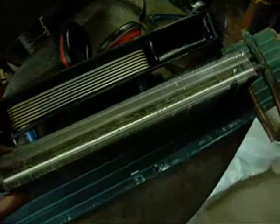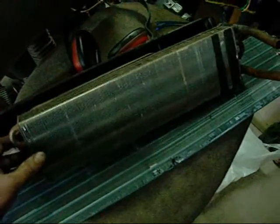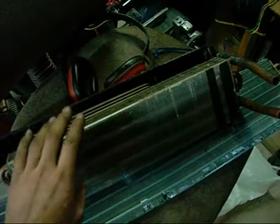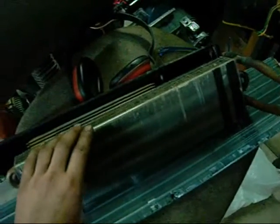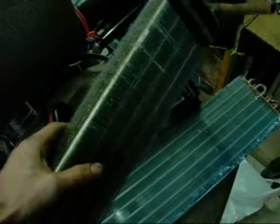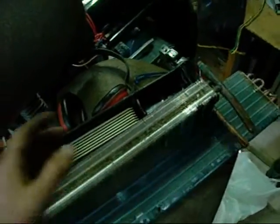I don't know how readily available old vending machines are, but I had the chance to rip one out a while ago. Unfortunately it was so low on gas it was pretty much useless, but the whole lot came out together — the condensing unit was sitting in the bottom of the machine and the evaporator coil is probably no bigger than this under the can compartment. It all came out together without having to unhook anything or degas it.